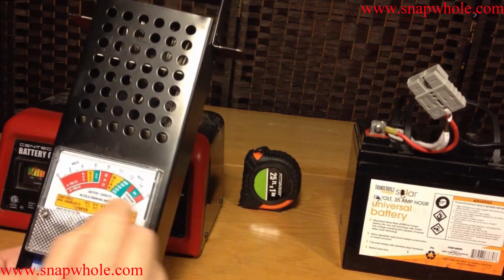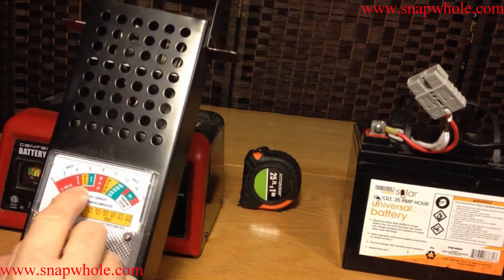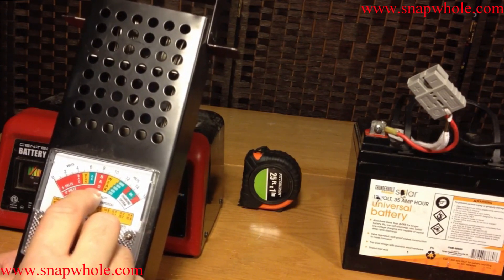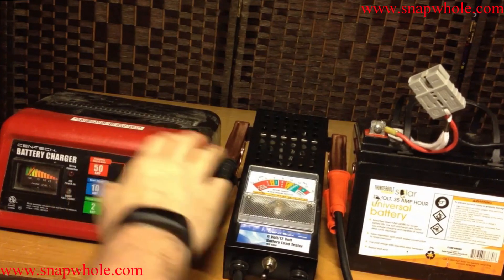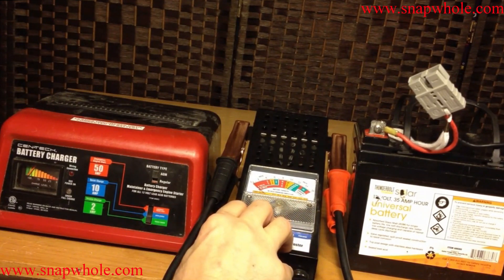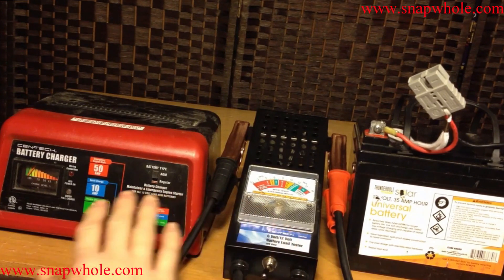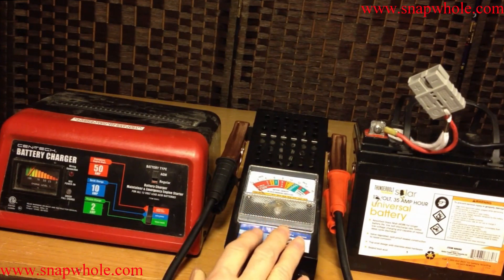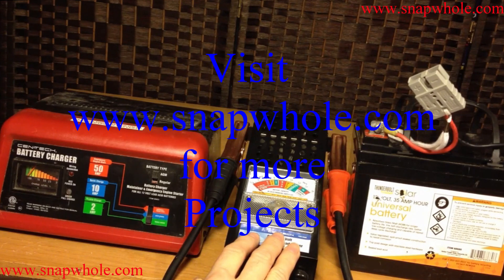That's why you need a battery tester. When it comes into the bad range, that's a sign you need to replace the battery — don't trust that battery to do anything. If you're going to have lead-acid batteries, you need a reliable way to charge them and a reliable way of telling you how good they are. Before we got the load tester, we'd get out and use a battery and only then realize the capacity was down. When you're actually using a battery away from the house, it's not a good time to realize something is wrong. I highly recommend going to this type of conditioning system — it will charge more efficiently and tell you what to expect from your batteries. Thanks for watching.